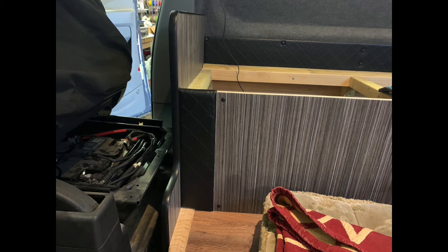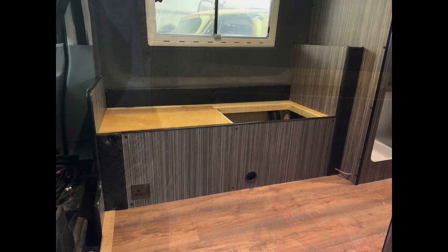It was a case of getting the van batteries charged up properly because we're not far away now. I'd already bought the mattress - a custom made mattress you can get off the internet. There's your sofa at this stage - the cushions were being ordered, also custom made. There's a 240 volt socket at the front and that front vent you can see there is the vent from the Truma. What I will say is that the vent has a flap on the front and the tube is very short - someone flipped the vent round and it actually melted the little flap. Word of warning: make sure your flap is open.